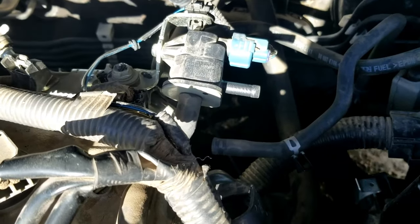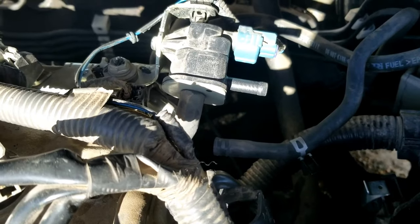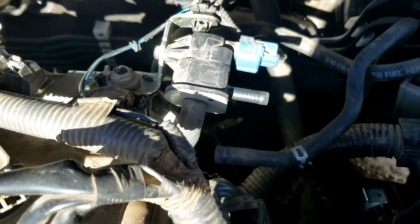That's basically it. I'm going to go start up the engine — first 5 minutes, there should be no vacuum. After 5-10 minutes, that valve should open and it should start pulling a vacuum. I'll be right back.